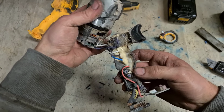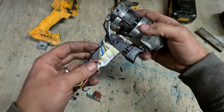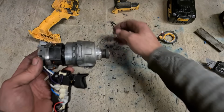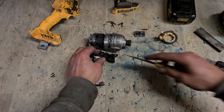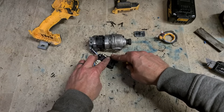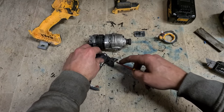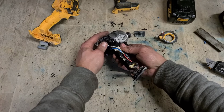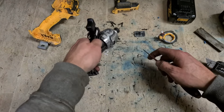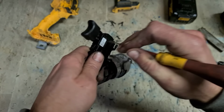First off, clean out all the dust and dirt from the switch. That's just to stop any dirt getting into the switch whenever we open it, and to help it last a bit longer once we've cleaned it out. So we'll keep this short and sweet because we have seen this before. Take off this cover, clean off the silicone here, so we can pull out these wires. Don't have to take it all off, just some of it. Don't damage the wires. Unhook these big wires at the back to give you some room, and prise up these little tabs holding on the front cover.